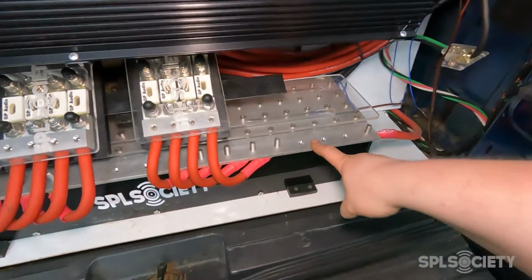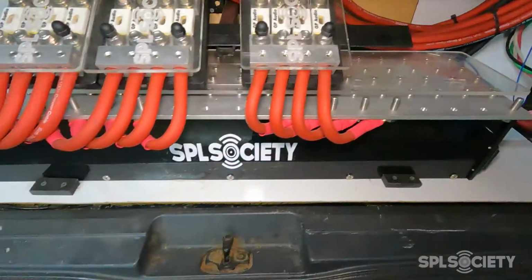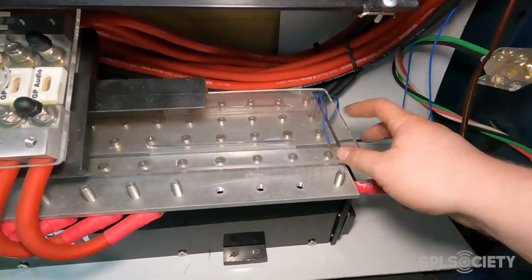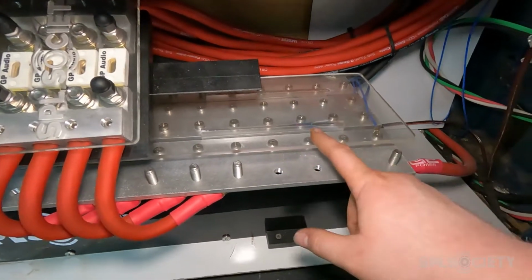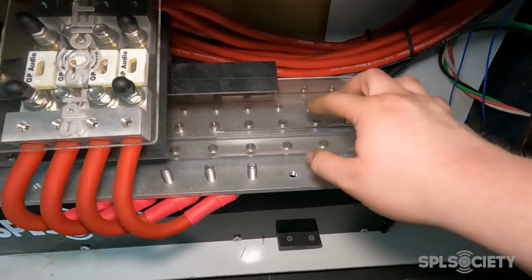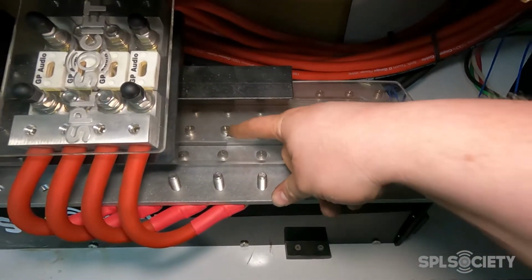So we got all of our aluminum bus bars together. We put together our little case, got a sticker made, and I built this acrylic cover just in case something falls down, Allen wrench or a set screw or something. I put this cover on top so that nothing can drop in between the cells and arc it out.